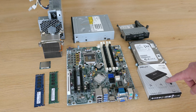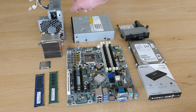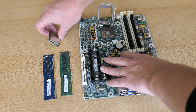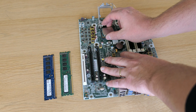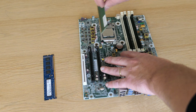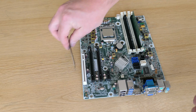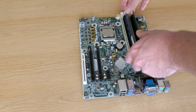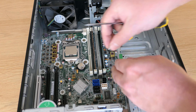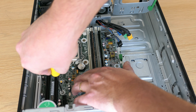To get better access to the CPU we can remove the plastic fan duct. The heatsink here is larger than what we see on average in a typical SFF machine and has a nice heat pipe on the side as well. To use the space efficiently there is no fan directly attached to the heatsink itself — instead it blows through it from the front of the case. We've seen a similar setup before on machines with Xeon CPUs. Then we can get the heatsink off the CPU. It's mounted through the motherboard directly on the bottom of the case. The thermal paste doesn't look too crusty, but I will of course replace it later.